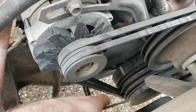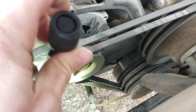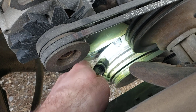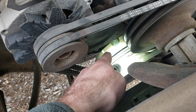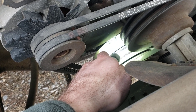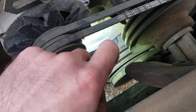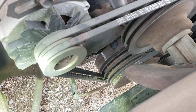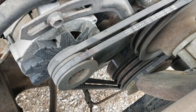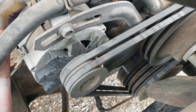Looking down at the marks — it's hard to see without good lighting, but I can see 20 degrees, and I can almost see 30. So this is really, really bad — I would almost say catastrophic. I have nearly 30 or more degrees of slop in this timing chain. It has certainly jumped at least once, maybe many times, and that's a big issue.